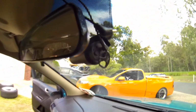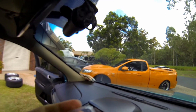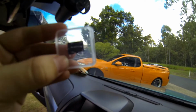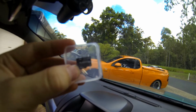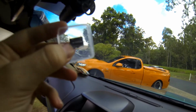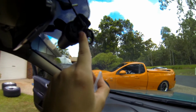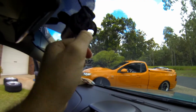So just before you end up plugging this wire in and actually closing this little cover on here, you have to find your Blackvue SD card that came in your camera. Mine actually is a 16GB version. You can use anything from a 16 to I think 128 gig, possibly even bigger, I'm not quite sure. But that just goes straight into the side of the camera right here. And then you close this little door up, and then you plug in your DC power.